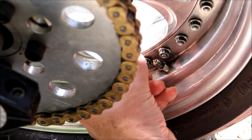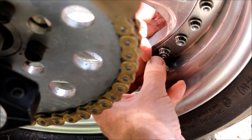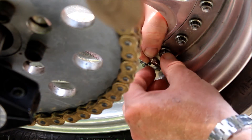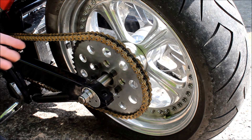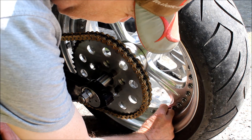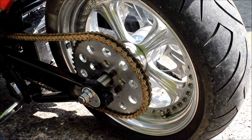Cleaned it up now and it's time to put the valve back in. I must say I'm a bit concerned that the gloop will interfere with the workings of a delicate valve, but I guess the guys who make this stuff must know what they're doing. Using this clever little valve cap with the built-in valve key to screw down the valve. I've just put 32 psi in this, and in a few days I'll come back and check it again to see whether it's stayed up or lost a few pounds like it used to. Hopefully it won't have lost anything. That 500ml bottle will actually do both wheels on a motorbike - they say you should use 250ml on each tire.